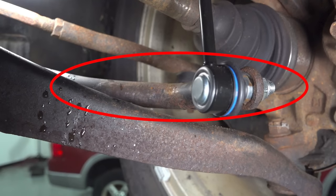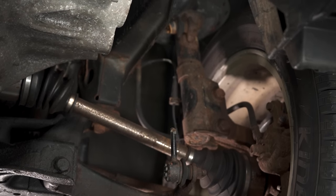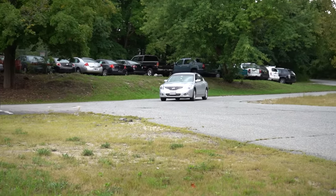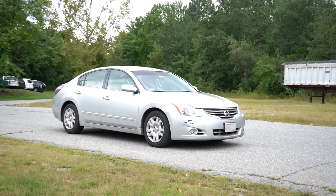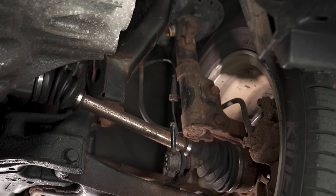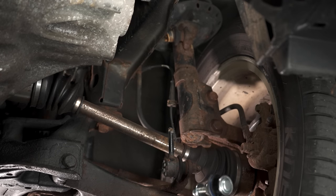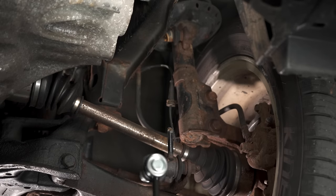It's in its name — it's a sway bar link. Here's the sway bar itself, and it goes over to the other side where this exact replica setup is. What it does is stop the vehicle from swaying. Not every vehicle has sway bar links — some have torsion bars — but they all do the same job. They stop you from, when you corner quickly and you've got to turn fast, they stop the car from rolling too much because the center of gravity on a car is above the wheels. So you would actually roll into the next lane or off the road. This stops the vehicle from shifting the weight too quickly, diverts it, and keeps it stable.